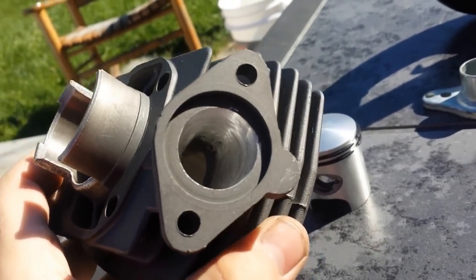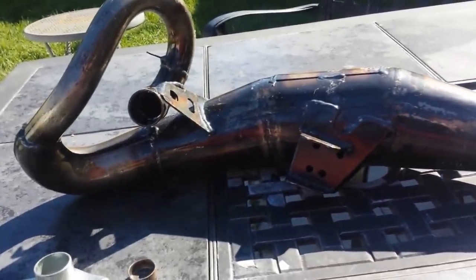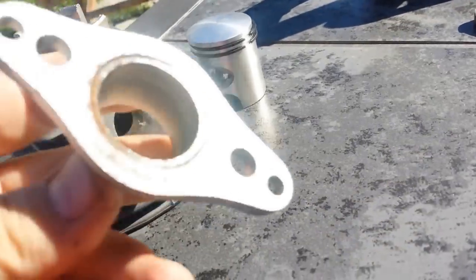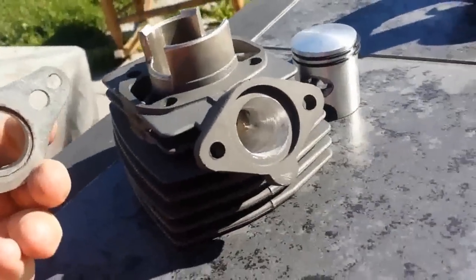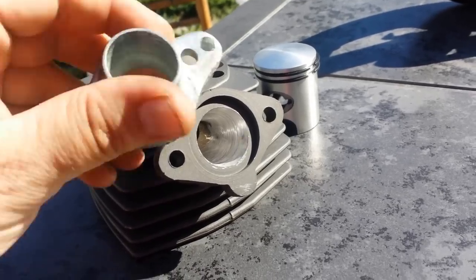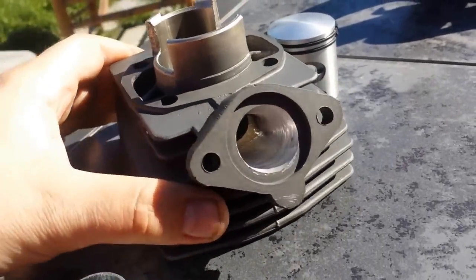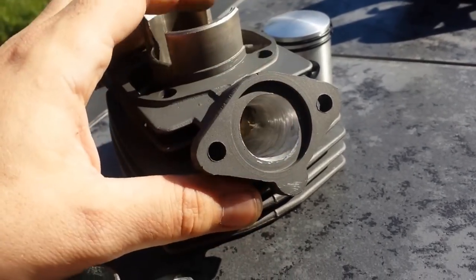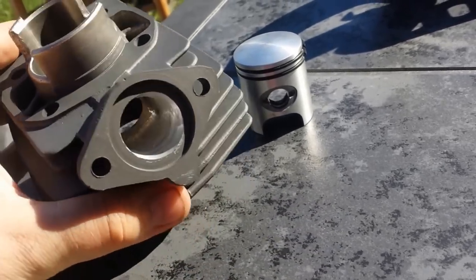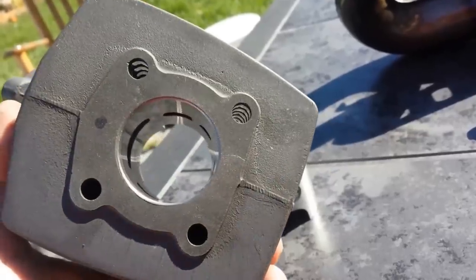The exhaust port I did open up. I'm going to be using this Simonini pipe, which I'll get to in a little bit. What I wanted to do is match the port up to the flange. You can notice it's no longer the screw-style mount you have with the stock Peugeot kit — it's just this flange deal. This is about 24.75 millimeters, and when you first get it there's a ridge on the inside. If you eliminate that ridge and open it up, it's pretty close to a direct match, which should help things breathe a little better. I didn't widen any ports or change the timing or anything like that.